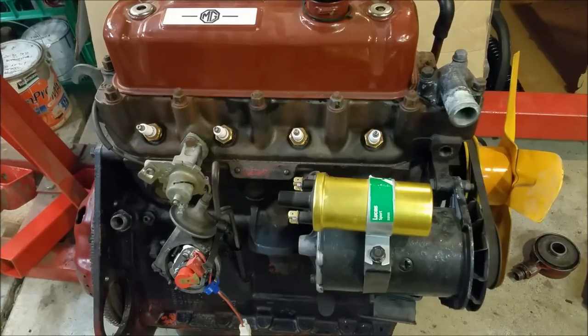One of the best modifications I made to this engine - that's a Lucas D4 distributor. Putting this magnetic pickup in freed the engine up immensely, made it feel a lot more lively than it did, and it started a lot better than it did before.